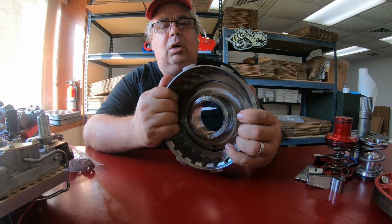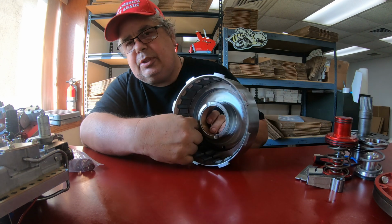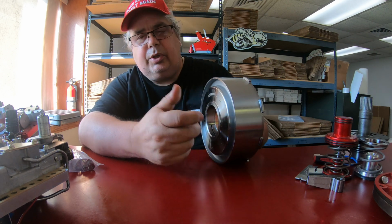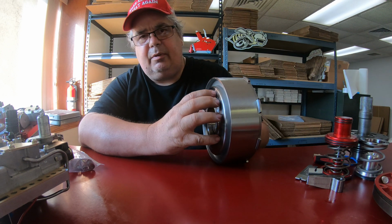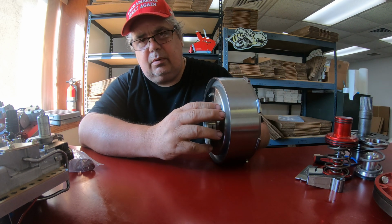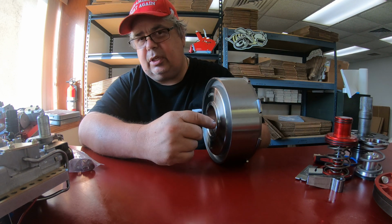Because you will have to drill a hole in the front drum as far out as you can without hitting the lip seal surface. It's a 1/16 hole, and what it does is when you're on the trans brake, you fill this front drum up with oil, and that turns on reverse, and it keeps the car from rolling. It locks the car up, and when you let go of the button, this lets go, and the car propels forward. But this drum still has fluid in it, and it's spinning counterclockwise,